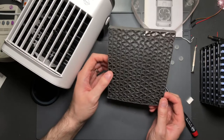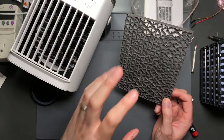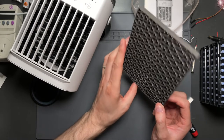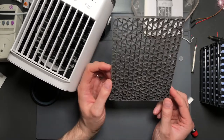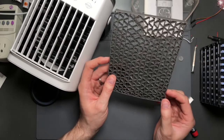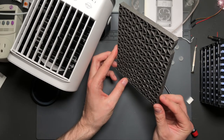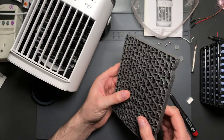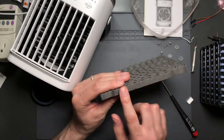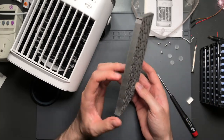Here's the water curtain. It looks so frail, and you can see where it's squished at the bottom. Without it you could probably still get some cooling performance, but in an evaporative cooling system the key is maximizing evaporative surface area. If you turn it on an angle, you can see just how much surface area there is for water to collect and evaporate. But there are glue globs everywhere, and it seems like it's just a paper fiber — not any sort of nano-woven glass or advanced material.